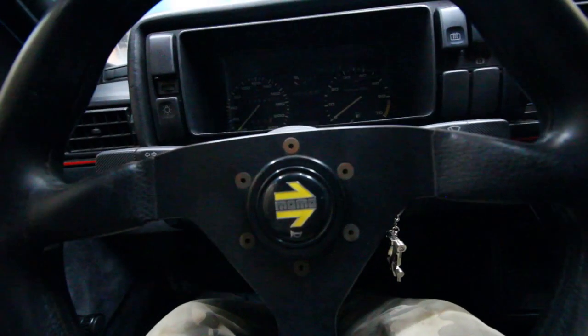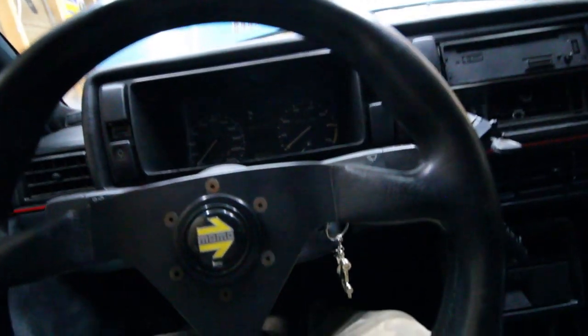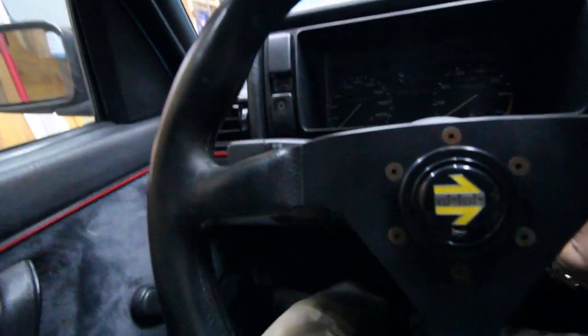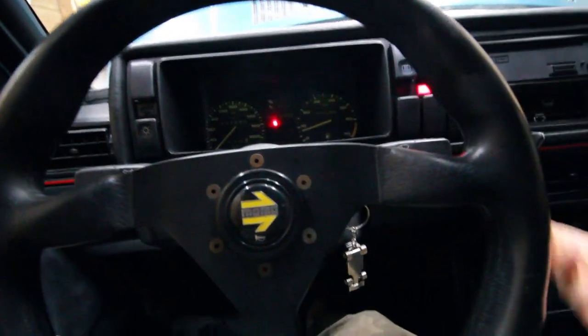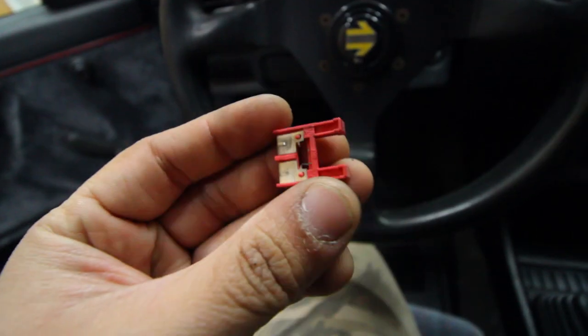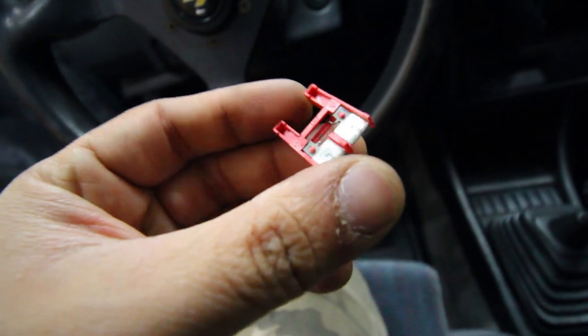So I'm deciding to run the car after all because the fan isn't coming on with the key switched to accessory. Still no fan. We might have found our culprit here — it's the last fuse in the fuse box, fuse 22. If someone can tell me what 22 is... it says radio. But who knows — let's go ahead and replace the fuse anyway.